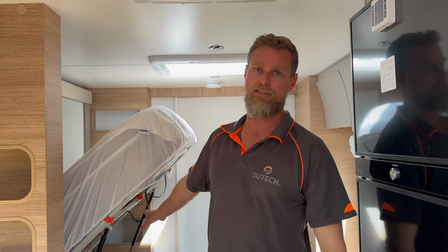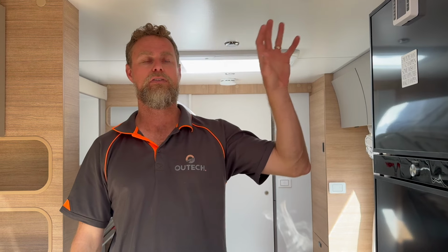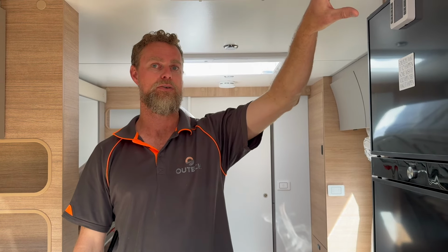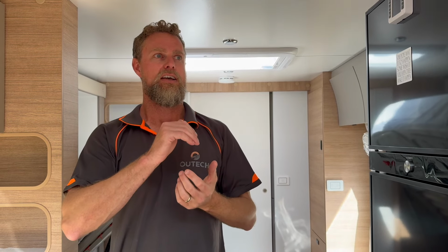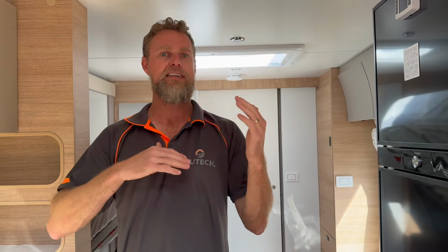But as we always talk about, these Projecta units, these 30 amp Projecta units, or the other brands that are 30 amp units, are just a little bit small for going to these bigger batteries. In addition to that, these Silverlines have a different control screen on them, which is more of a touchscreen based screen, which is designed by a different manufacturer than Projecta. So it's kind of an interfacing thing that gives you a little bit of limitation with the size of battery you can use.